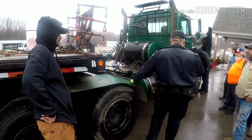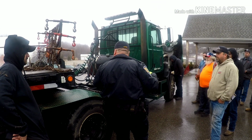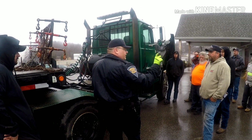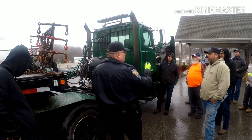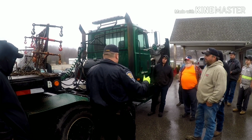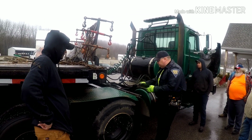And a lot of that you can tell by looking at the brake chamber, especially on these ones that are partnered with the parking brake. If they've got the square ports or it's got a real long section in between, that's usually a long stroke. Or if it's got the trapezoidal tag, either embossed or stamped in the middle, or a tag on the brake chamber. So, on that. We're working our way back now.